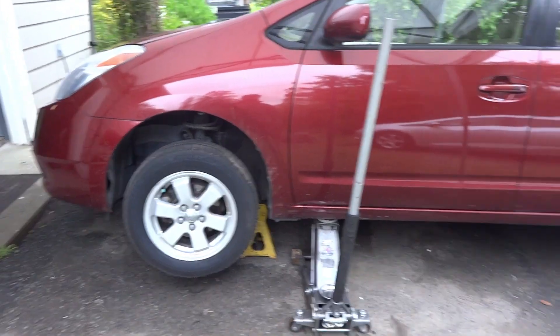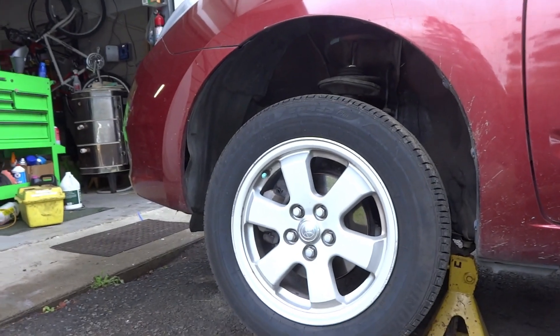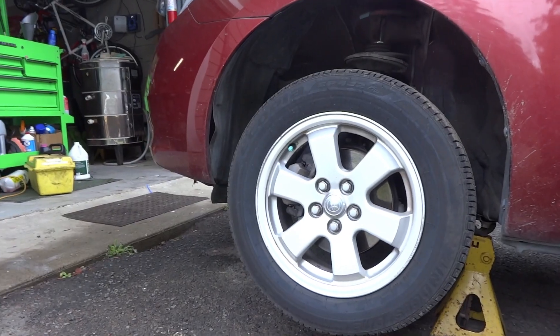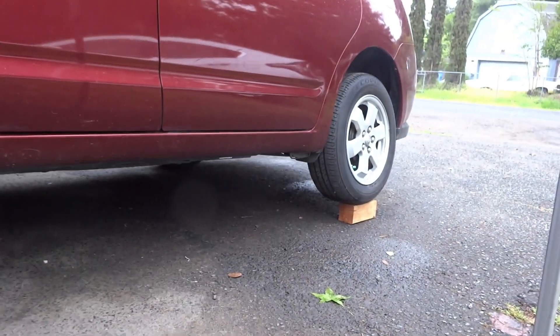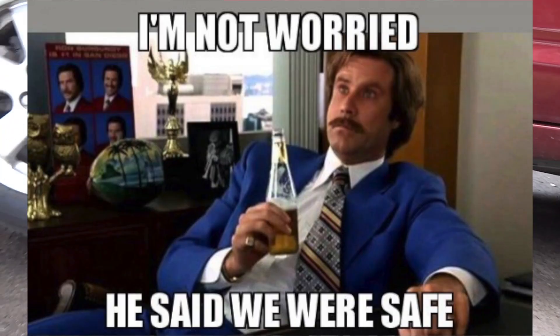Okay, Prius 2nd Gen — this is kind of the prep you want to do. If you have a lift, obviously that's great. Otherwise, get the driver's side up and you're going to be taking off some of this front wheel plastic stuff to get to that coolant storage tank, and we're going to drain the coolant from there. I have it on the block back there, parking brake's on, jack stand there, and the jack has extra safety, but most of the weight is on that stand.